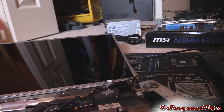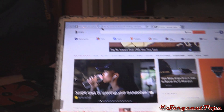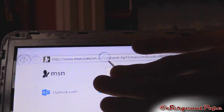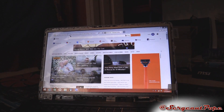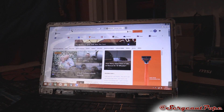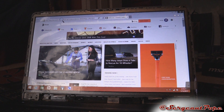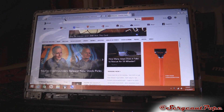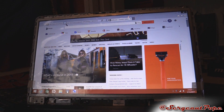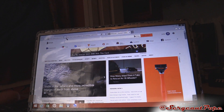Here's the final update on the HP laptop — look at that, new screen and it's working! The protective film is still on the screen. The backlight broke out on the screen itself, so not too big of an issue — just replace the screen. Even though this is a 17-inch screen, it was about 60 or 70 bucks. If you have this issue yourself, it could be the screen, but it also might not be, so don't just go out and buy a screen — you always need to test other things first, like the connections on the screen.